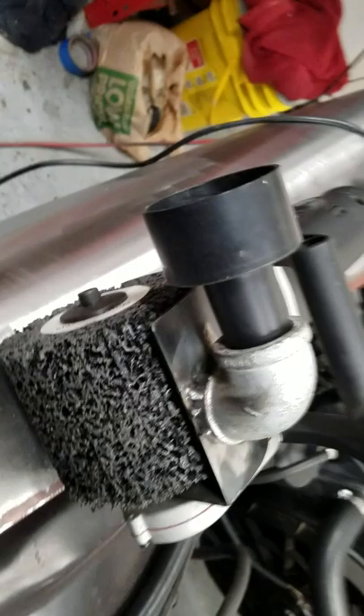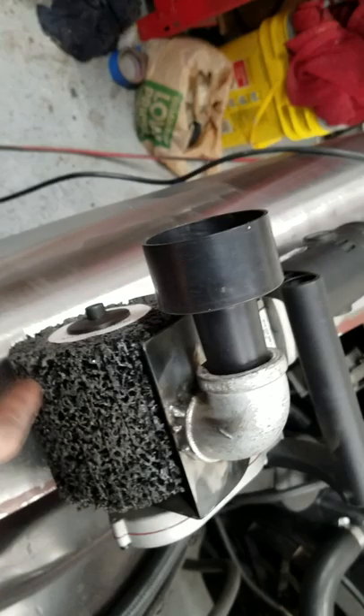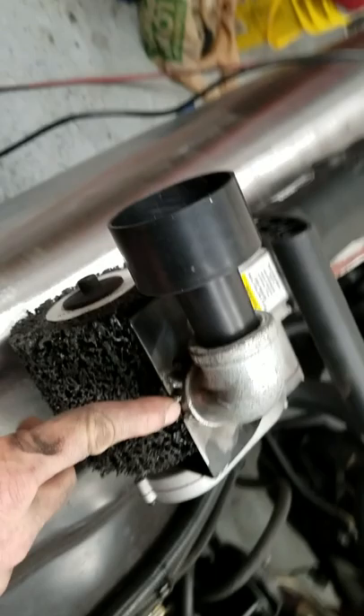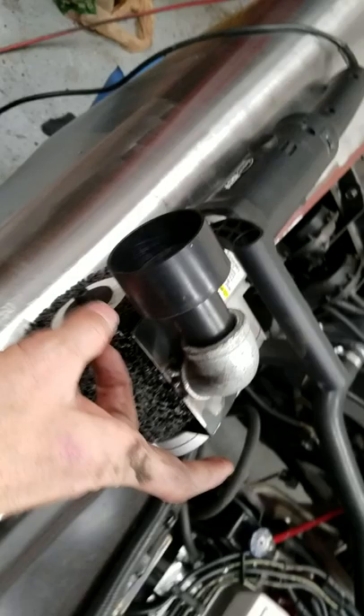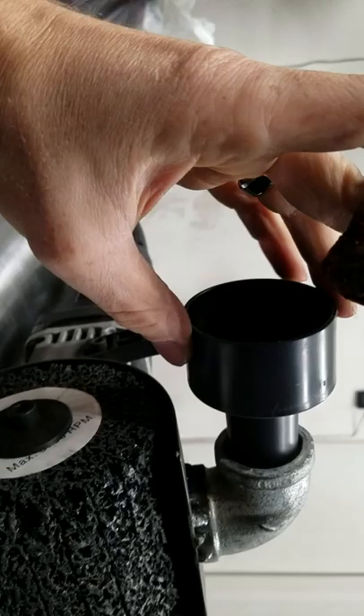This was just something quick to test the idea. I went out and got an inch and a quarter steel pipe fitting. I drilled an inch and seven thirty-seconds hole, and that was just the right size to match the opening of the pipe fitting. So I just did a quick tack — I didn't even care, like you can see there's a big gap right there, but this was just a test. And then I was basically able to screw in this attachment fitting and hold it in place.